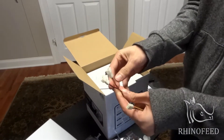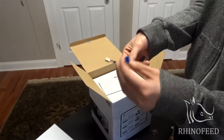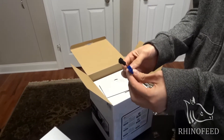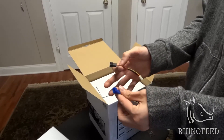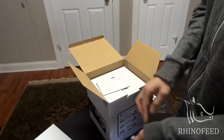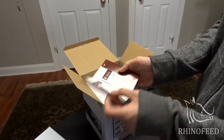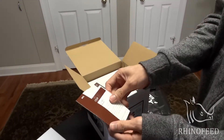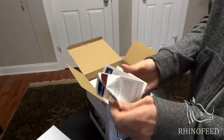Here's your Y fan splitter and your two ultra-low noise adapters — I don't know why this one is blue — which will drop both fans down: their 14 centimeter fan and their 12 centimeter fan, down to 900 RPMs. You also have your manual, which is kind of cool — it's tiny — but it covers your Intel side and your AMD side.